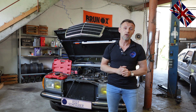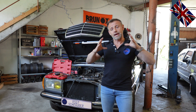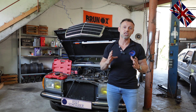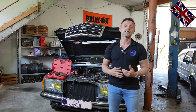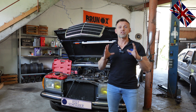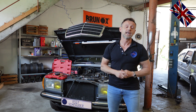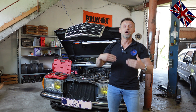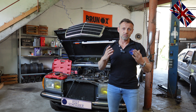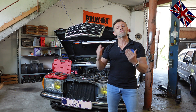Today we check the functions of a WUR while being mounted. This device has to regulate the fuel pressure so that more or less fuel, according to the temperature of the engine, arrives at the fuel divider, which ends up in the injectors. Therefore, the position of the pin in the fuel divider alters the flow to allow more or less fuel to be pressed to the injectors. And how to check those pressure parameters is today's menu.